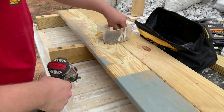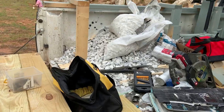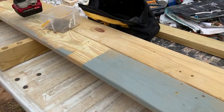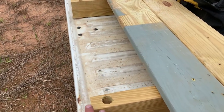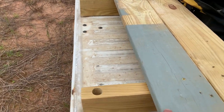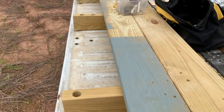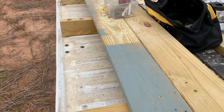We are out here today working on a bulletproof tailgate — this has been requested. We also did a bulletproof truck bed; if you haven't seen that video, go check it out. This is a shrunk-down, thinner version. We're going to frame out this tailgate, line it back with decking boards, fill it with gravel, and see what it can stop. We also want the tailgate to still be functional — opening and shutting — so you still have access to your bed.